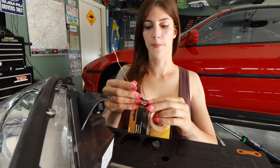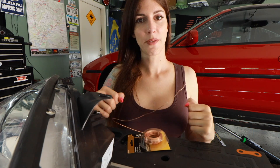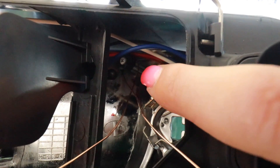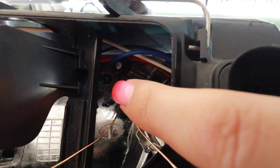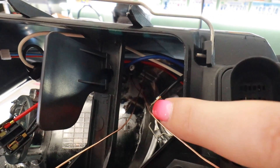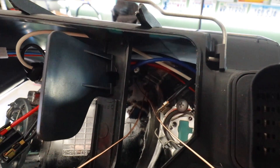It's the next day and I have some safety wire. I'm going to show you a little trick I learned in the Air Force. I don't have safety wire pliers but I'm still going to make it work. I'm going to take the safety wire and the two broken halves inside the headlight and tie them nice and tight. This wire can withstand heat and it's really strong — this one's 14-pound test. I'm going to loop the safety wire around the little black plastic piece with the screw, and then loop it around the little plastic ball — those are the two halves of the headlight that are supposed to be joined — and tie it nice and tight to hold the pieces together.